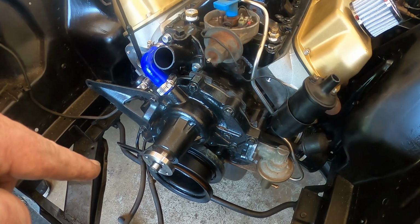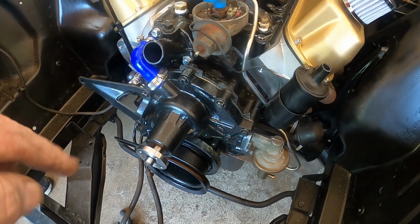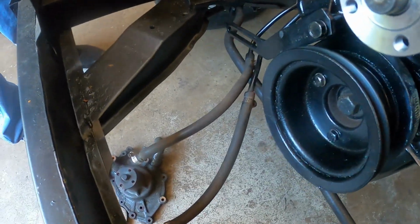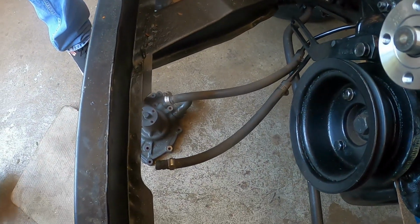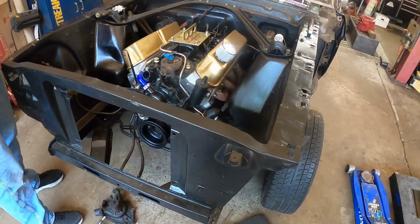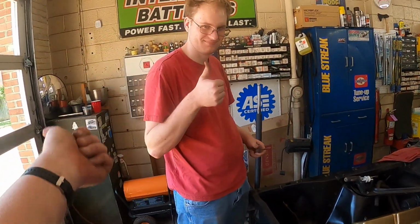Do you have the fan and the pulley? We're gonna get the fan, the pulley, and the belt put on, and we'll slide the new radiator in, and then we're gonna have to bend the trans lines so they'll work properly. We'll just run those hoses for now and change them later, I guess. We did flush the lines out, so it's coming along good. G Junior is doing an excellent job.